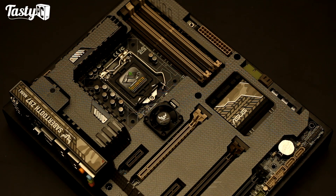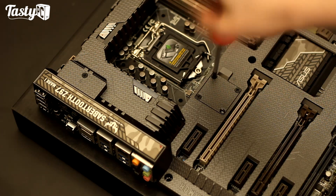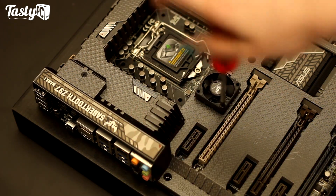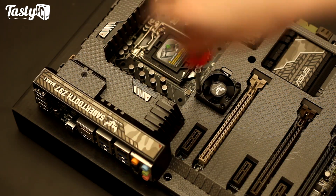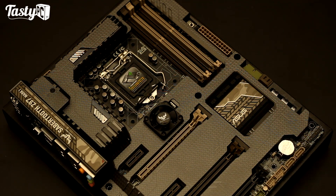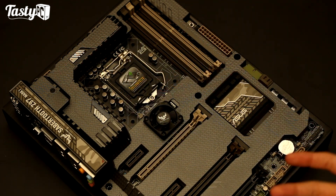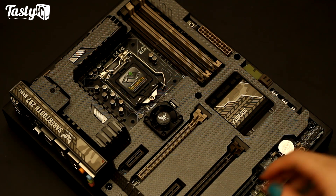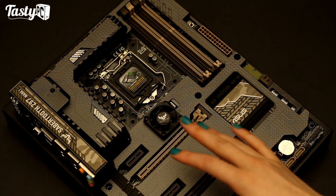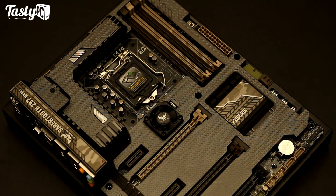The Sabertooth Mark 1 is configurable with two different fans. A 35mm fan which you mount here, either intaking or exhausting, and its job is to cool the bottom half of the board. I do worry that if you've got it intaking, it might pull hot air from your GPU straight underneath the armor and raise your motherboard temps, or if exhausting it might suck in air from around the socket and be a little redundant. So if I was setting this board up I don't think I'd fit this fan at all, and hopefully the thermal armor will act as a heat shield keeping the graphics card's heat away from the motherboard.